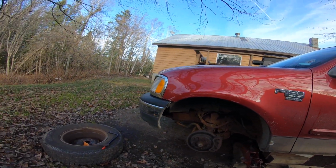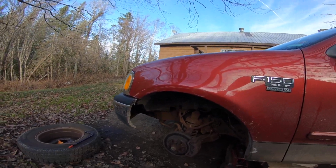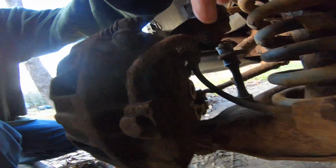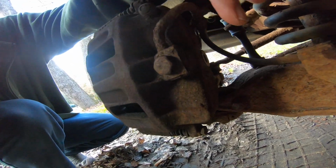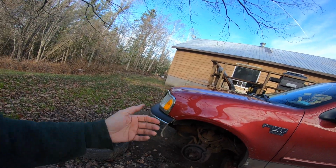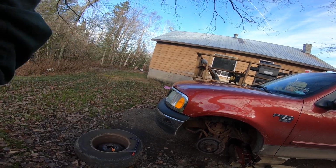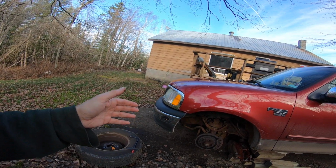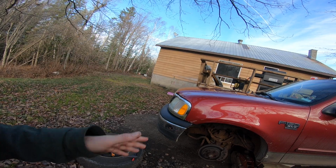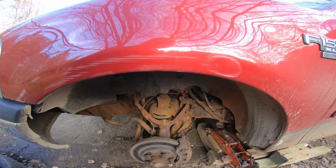Now my concern is not the brake pads. Brake pads are cheap. My concern is right here where your pucks are, your pistons are. There's a seal kit and all that. If it was the actual piston pressing against the rotor, number one, the rotor doesn't feel like it's warped when you're driving it. It doesn't do that. So it was literally the brake pads. So maybe I got lucky, and the brake pads just fell out when it did. It didn't actually do any damage. I mean, these obviously have to be cleaned up.